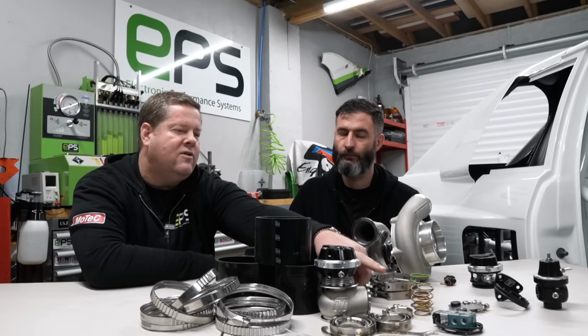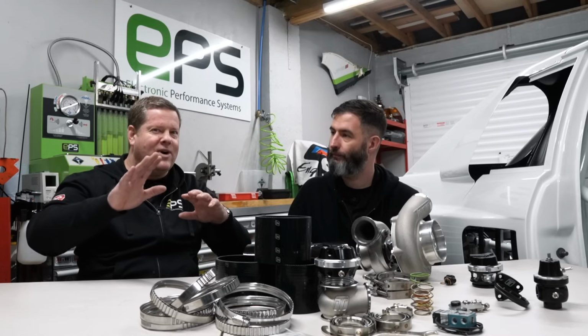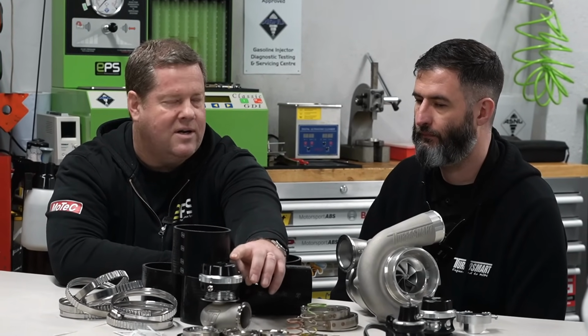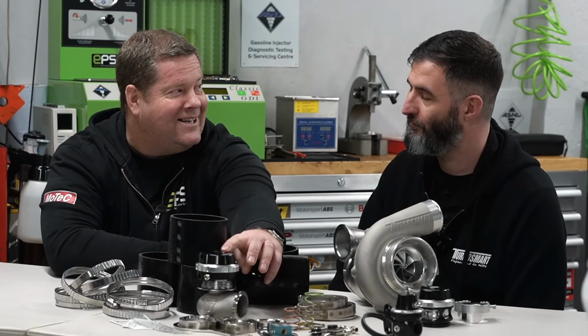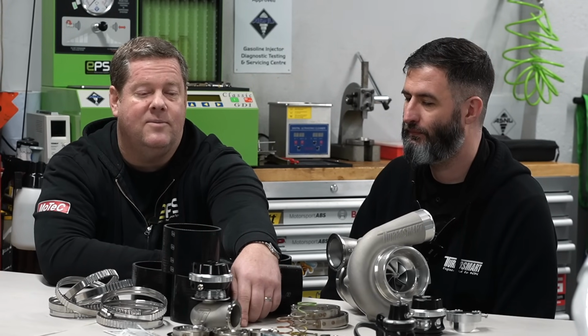And then with the boost control valve, the four port, you could put in the ECU mapping a little bit of throttle progression on the boost control strategy. And so it drives a little bit more like a normally aspirated car, isn't it? And also you don't want it too high, because the traction that you get in the lower gears, or your driveline, might be too much for it. So that's why having these springs available when you first get the wastegate is quite a good thing. You could then try out, it's all right, might take 1.3 bar on the start line, might take maybe more. Everyone wants to fiddle with things, so having the parts available is definitely the way forward.